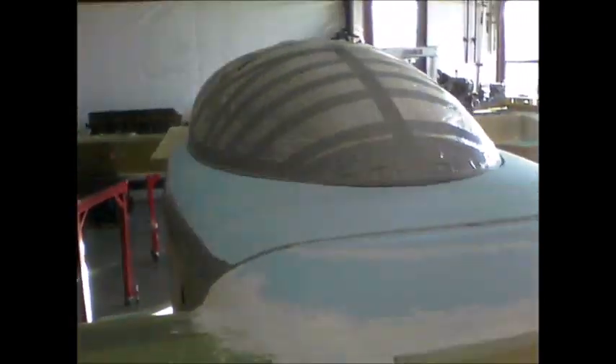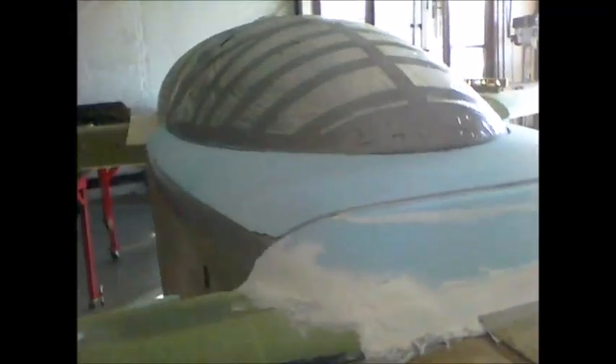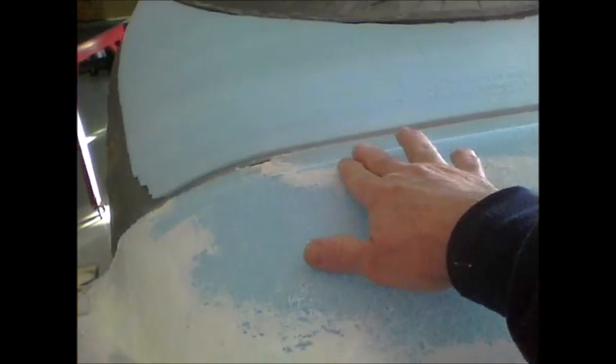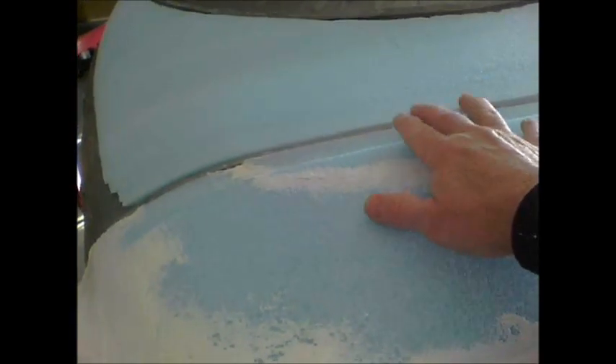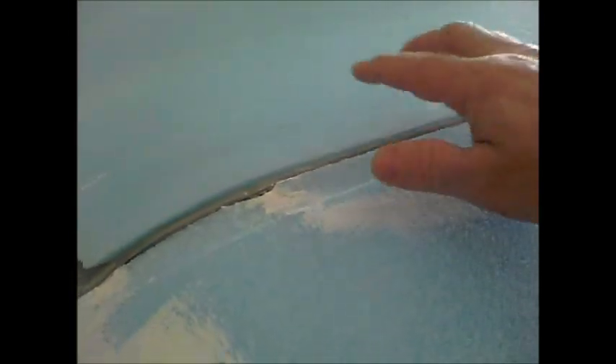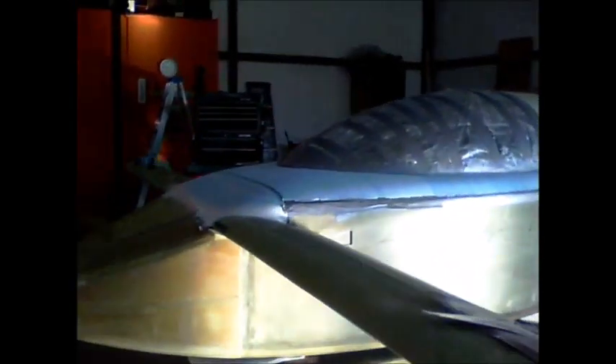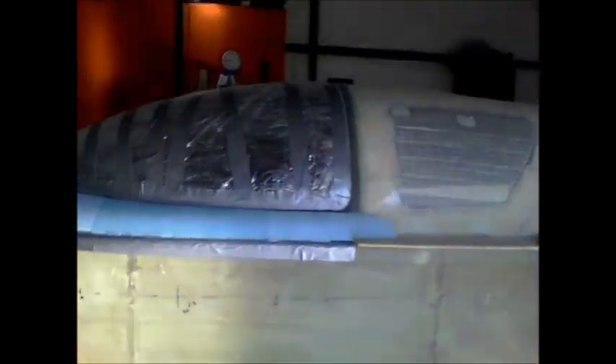We have contoured this — it actually went a little faster than I thought, only took a few hours. I'm almost ready to start glassing. I'm going with the forward hinge canopy, so I've sanded a little joggle right here so that when I lay up the canopy frame, the fiberglass will come to right here on the inside and seal this part. It turned out pretty good — you can see the contours of the airplane now; looks pretty sleek, everything's good and symmetrical.